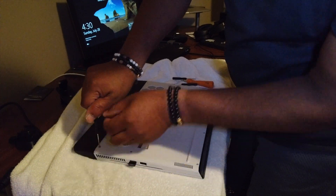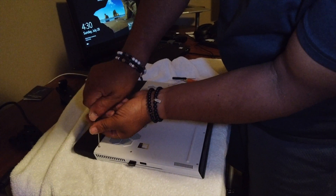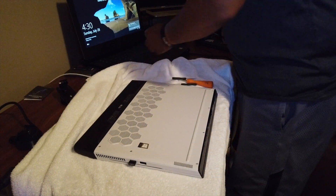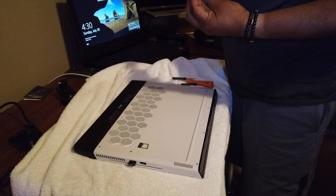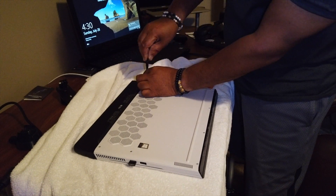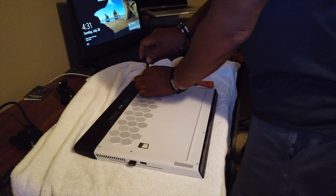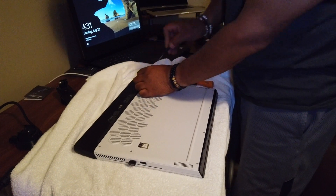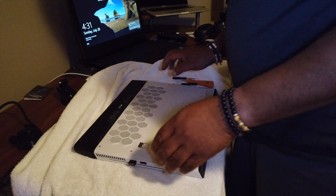I'm not going to copy anything over. This is just going to be a net new drive. I think there have been some issues with the new sector sizes — some of these being 4K — which causes problems when you try to clone your drive over. So we're just going to do net new.